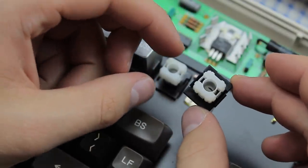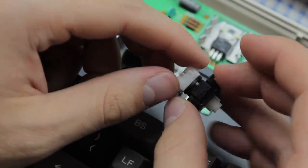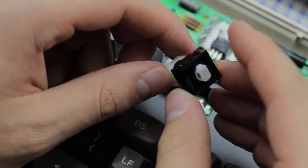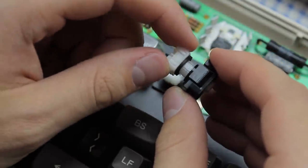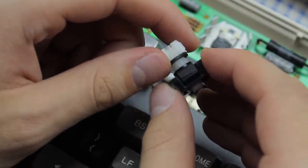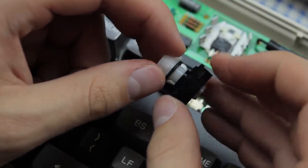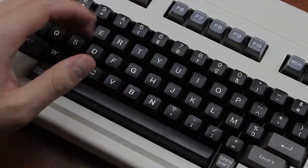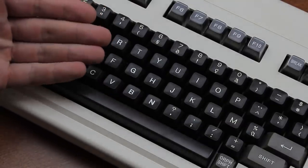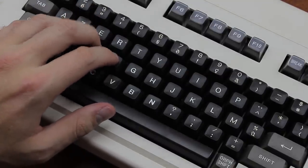So, like FLS3, the FLS2 design is broadly the same, except with a few more bells and whistles, and the details are slightly different. Like FLS3, there are sliders that are pre-installed in a detachable barrel clipped into a mounting plate, but each unit contains a rubber O-ring to dampen the switch sound. It also comes pre-lubricated, which I don't think is the case on FLS3. The lubricant and perfect condition of this unit — which is important as FLS are not immune to dirt and especially heavy use after all — make an already smooth switch smooth to top-tier levels.